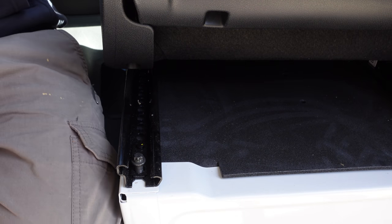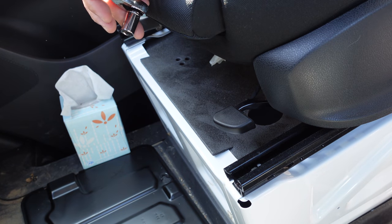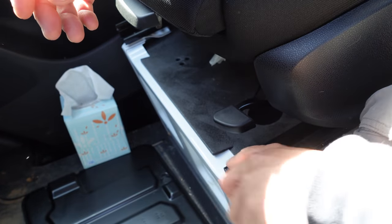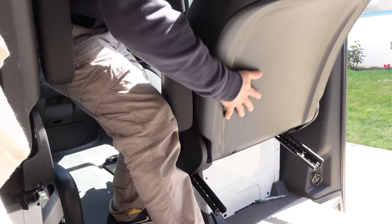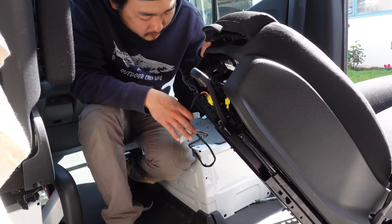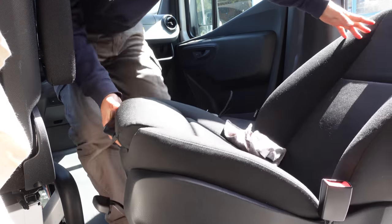I'm going to bring the seat back and do the front. I'll leave the bolts in my cup holder — everything's going in there. All right, make sure to take the back ones off now. I only loosened the back. There we go, it's coming off now. As you can see, there's a wire connected onto the seat so I'm going to have to take that off. There we go — it comes off, just got to pinch the buttons. And I'll put the seat off to the side.